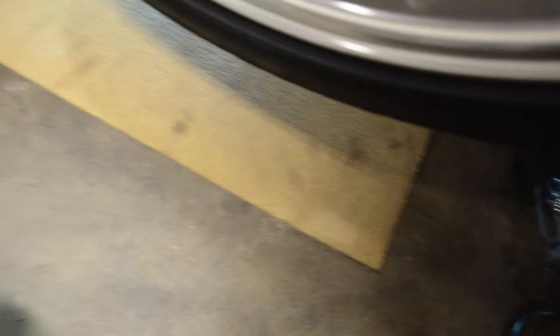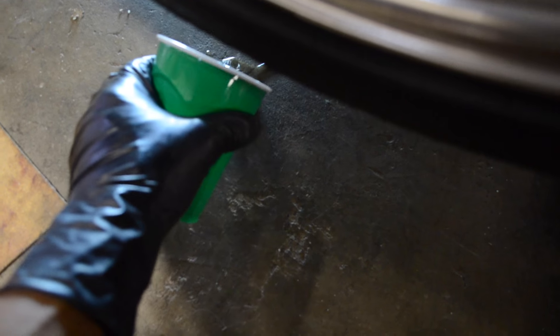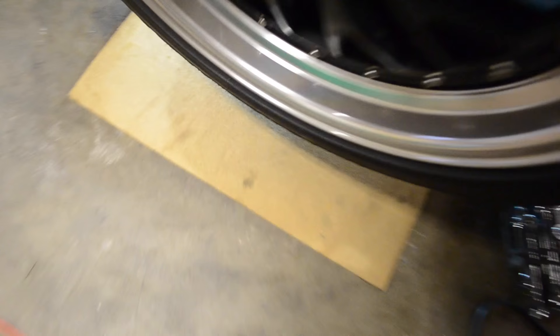The skid plates — you're going to put them beneath the wheels. I'm going to lower the car back down on the ground since I've already taken it off the ramps. We're going to put these underneath, and this is going to allow the wheels to slide into a natural position. In order for this to slide really nicely, there are two sides to this masonite — a smooth side and a textured side. The smooth side goes toward the ground. I'm putting a little bit of water with a lot of soap in it to allow this to slide more freely. I'm doing it on both sides.